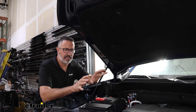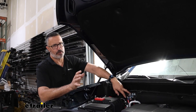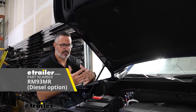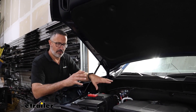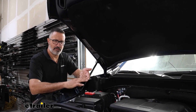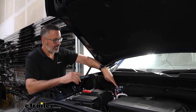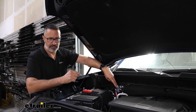I do want to let you know right off the bat that if you have a diesel engine, this disconnect is not going to work for you. Those engines have too much of a startup amp surge. This one is rated for gas motors — the 5.3 or the 6.2. The constant amp rating is 200 amps, and the surge rating is going to be 600 amps.